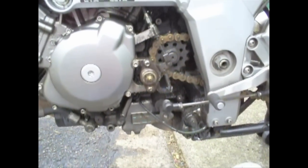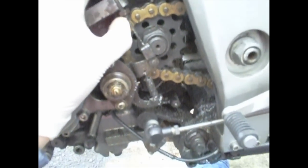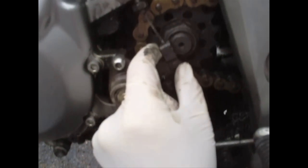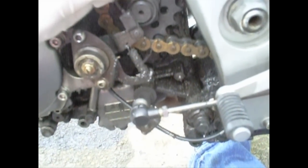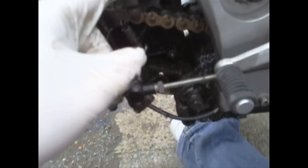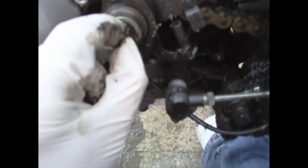What I've done here is released the clutch cable — that bit there — which means I can release this from inside this unit here. The end of the cable comes into a small bendy metal clip in there which you need to release, and then you can pop that out of there, just like that. One clutch released. This unit here is my worm gear.